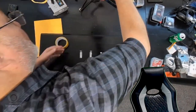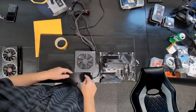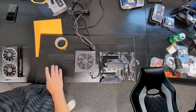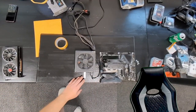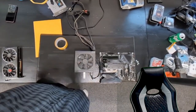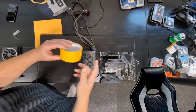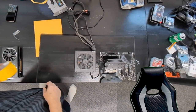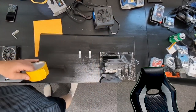Okay, so now we've got that piece in place. The power supply can still move around — gravity will hold it down on that side. How we get it fully held in place is simple: we take another one of these brackets, line it up right here, and pop it on the back just like so. That applies the pressure so it won't move up or down. But there's an extra trick — double-sided tape. In this case I have some double-sided carpeting tape left over from putting carpet in this room.